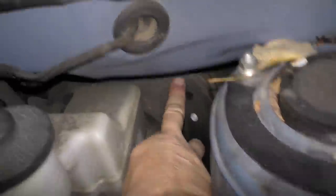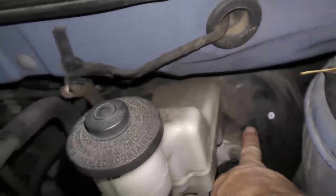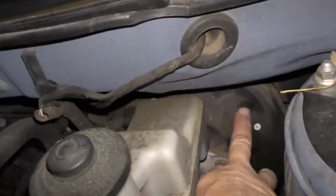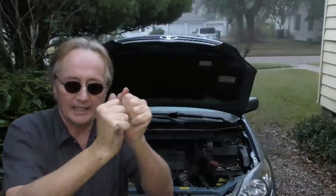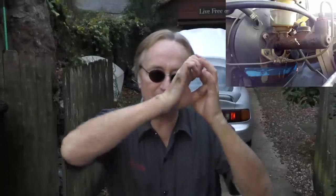On this Matrix you can easily see it — there's a master cylinder, it bolts to the brake booster, which is this big round black thing. It will leak inside here. This is a sealed unit, you won't see the fluid. The only way you can see the fluid is when you pull the master cylinder off — you'll see that the brake booster has fluid inside it. There's not supposed to be anything inside the brake booster except air. You start your car, you get vacuum pressure; the vacuum hose goes to the booster and it gives you boost. So if your pedal is sinking and you're losing brake fluid but you can't see it leaking anywhere, pull off the brake master — odds are you'll find the back of the brake master is leaking and the booster has fluid in it.